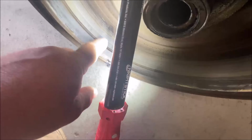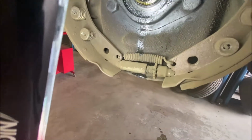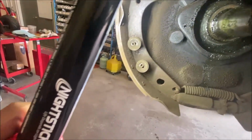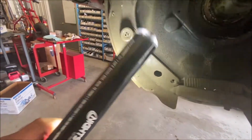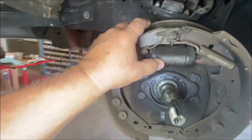So this has to be sanded. I'll sand it by hand. Clean it and sand it by hand. It's pretty dirty, you know, dusty like all brakes are. This all needs to be cleaned. These are not self-adjusters. These are manual adjusters. Typical on 62. It's correct. Each shoe should be held with two nails and springs, retainers to hold it to the backing plate. Each side has two.